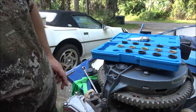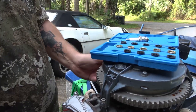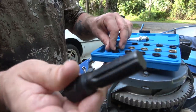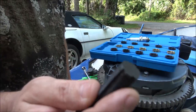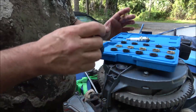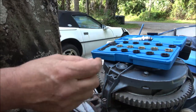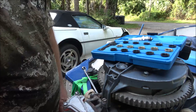Just check how deep you're going to go. With this on here, I can feel the piston — you want the piston down, all the way back, for this to go in. We're going to put some oil or grease on here so that as it's cutting the threads, it should catch about 95% of the cuttings and bring them out. There may be one or two little shavings in there, but it's not going to hurt anything because the rings are steel.